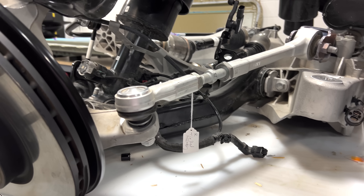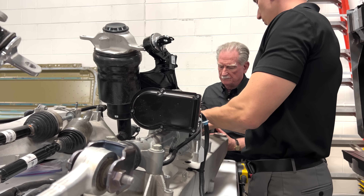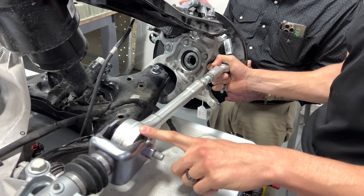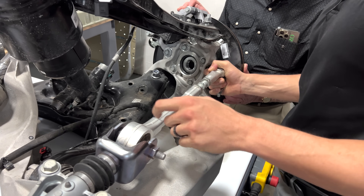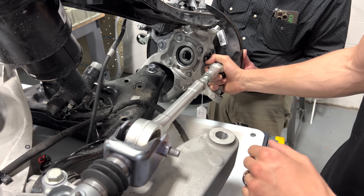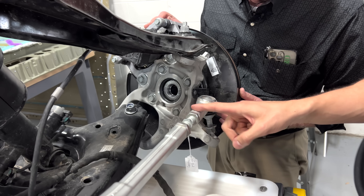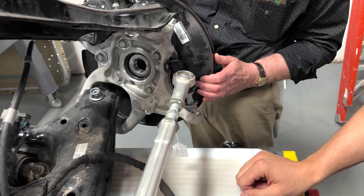One thing somewhat unusual is that you don't have a ball joint here. Usually a steering rack on the front needs to articulate quite a bit through the stroke. But in this system you maximally have about 10 degrees, so a bushing is sufficient — it's a more efficient way to construct a joint on your tie rod. It looks like you have a forged tie rod, and it appears the whole assembly is forged together, cut in half, and machined at each end.